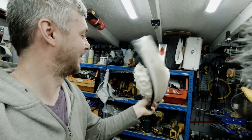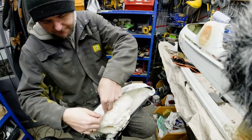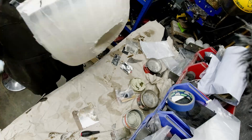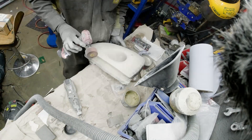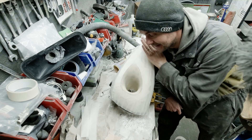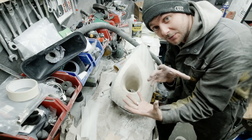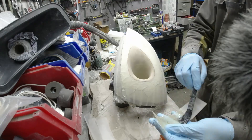That's what it looks like right now. It's all dry so now let's start shaping it. The air vent — I really like how it turned out, it's nice and smooth. So now we have to make a plug: put the release wax, then put lots of fiberglass in here, let it dry, and theoretically take it out. The negative will be the mold for making the part, then put it back with a couple of rivets.